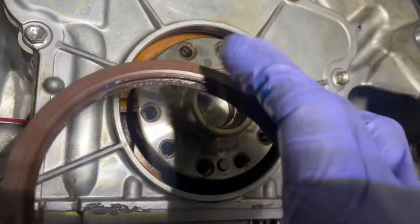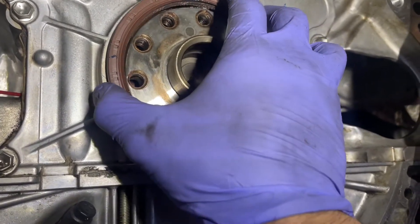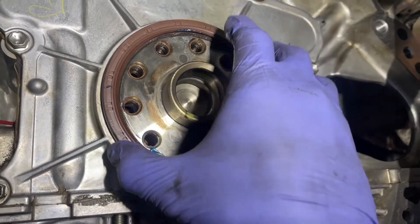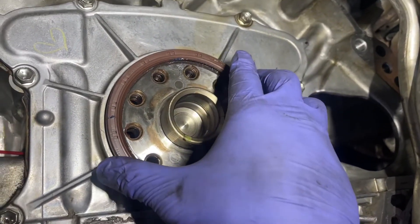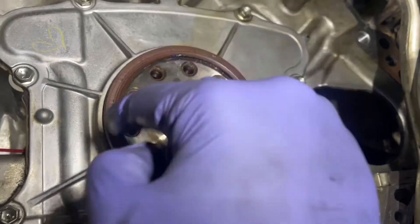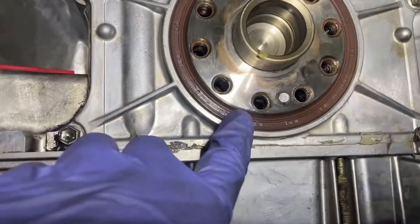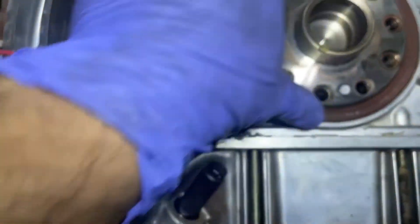With a little grease on the inside, you're going to work it in — push down on the lip so this inner portion goes flat. Work around pushing the lip so it doesn't flare out. I do have a tool to knock it in evenly, but I'm just going to use a small mallet and a small brass punch — it won't cause any damage. Just go evenly around until it's flush. Our new rear main seal is in — I used a quarter-inch extension with a dead blow mallet, went around until it was nice, even, and flush.